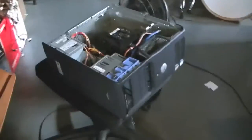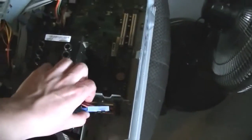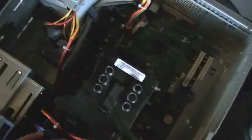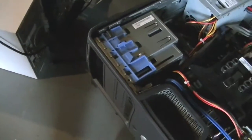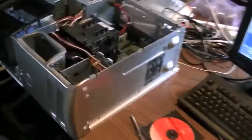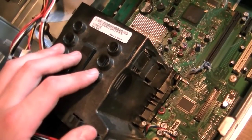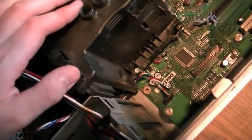Anyway, back to the 3100. Actually, I think I mentioned pretty much everything on this. So yeah, for this one I just need a SATA hard drive. Could use some more RAM, though it's not really a necessity. It's only got 2 RAM slots though, so I'll probably keep this RAM in it. And yeah, need a SATA drive. And actually I'm going to mention with this thing, after I started it up the first couple times, it said that there was a CPU fan failure, and I assumed that the fan was seized up and I needed to go through the painful process of replacing it, but it ends up that's not the case. It's simply that the connector wasn't plugged in, so that was an easy fix. Much easier than expected.